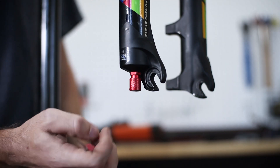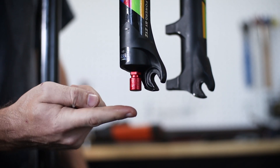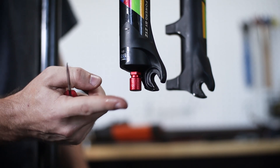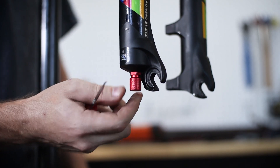So this is what we're looking at on the GoPro — this is the rebound knob, and this is attached to the damper shaft. With it punching through the lowers like that, that's a big deal because it's not even screwed into the lower, and this little nut right here is the only thing holding that damper onto the lower.